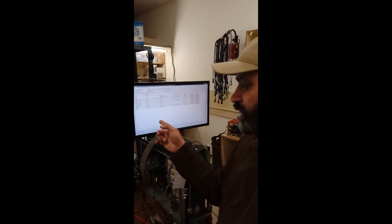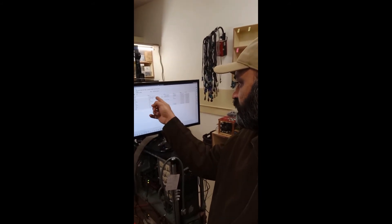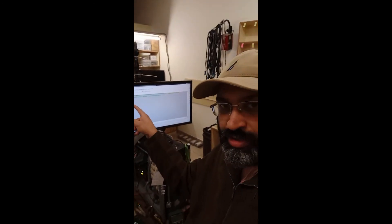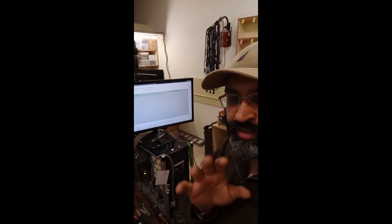I am now cloning the C drive. You can see on screen it's around 48.7 GB total, and approximately 12 GB is finished so far. Once the C drive clone is done, I'll move to pass 2. In pass 2, I'm going to focus on all the sections and sectors that were not read in the first pass and try to read them, to grab the maximum amount of data from this failing hard drive. Here we are now, focusing on all the areas that were left by the tool in the first pass.